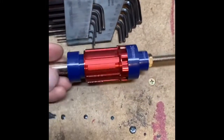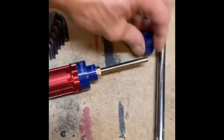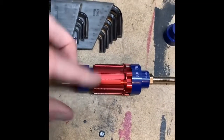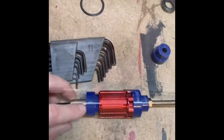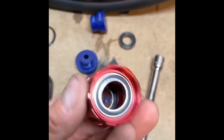I will use this special tool just to make sure the bearing is seated. This is the little tool — it has the right size adapters, kind of plastic so they don't mess the bearing up. Then you just screw it together and it slowly presses the bearing in. So now this one and the one inside are flush as well.